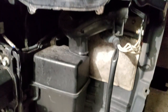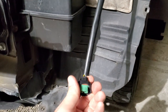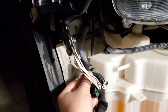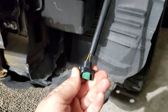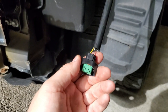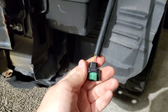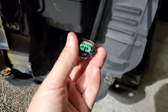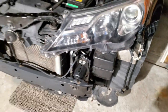The first thing you need to know is that your vehicle is already pre-wired with connections for your fog lamps — look at this, very nice good quality wiring. So do not install those cables that come with your kit. It's very hard to install them; you have to puncture holes through the rubber, through the grommets, and wire all those wires inside your cabin. It's a nightmare, way more work. Just make sure you clean the existing connectors and they'll work perfectly.